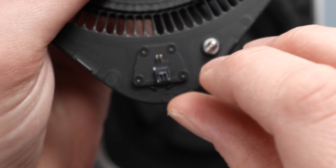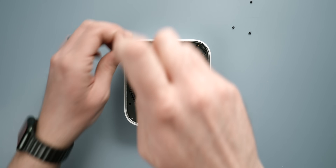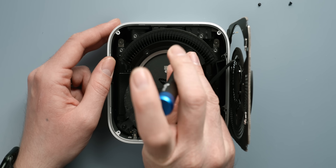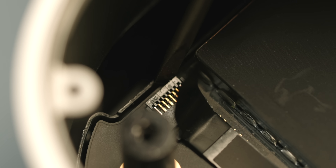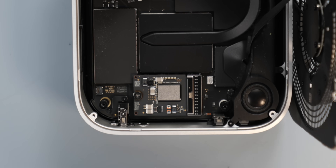We followed the guides to the nth degree, so it's a huge shame to have damaged something this early on — this is the kind of risk you take by opening up your Mac and doing open-heart surgery on it. However, this is classed as a user-replaceable part, meaning the damage may be solvable — more on that later. Setting that aside, we move on to the eight T5 Torx screws securing the plate, then three clips to release before lifting that piece. The last obstacle is the fan — two Torx plus three IP screws, and two Torx plus five IP screws between me and the SSD. I disconnected the fan, peeled back the tape, opened the connection and removed the ribbon cable — though as long as you're careful and don't strain it, you could probably skip that step. And there it is: the SSD.